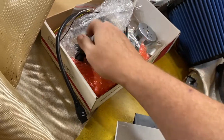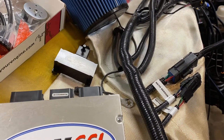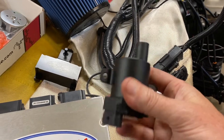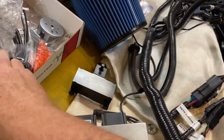I am doing coil on plug — this is one of the nice features. You can actually use a crank trigger that Pro-Am sells, though I'm not using that. This uses LS style coils. It doesn't come with plug wires because everybody's application is different, so that's something you have to source on your own.